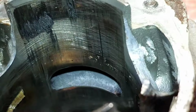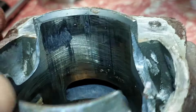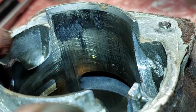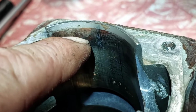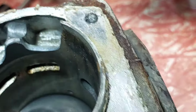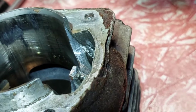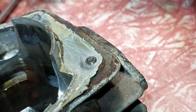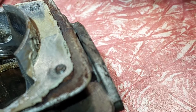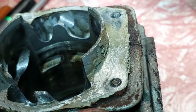There you go. It's just left a mark on the very base of the cylinder, where I suppose the piston stops just there when it knocks. Same on the other side. It's open right up and flows really easy, and it revs hard. But my theory was less skirt, less pushing fuel into the cylinder, better fuel economy, and still have power. It works, but doesn't have torque. I could change the ignition timing, but I haven't done that.